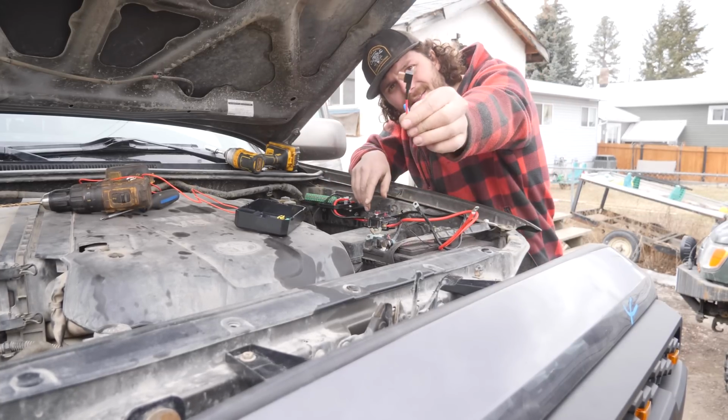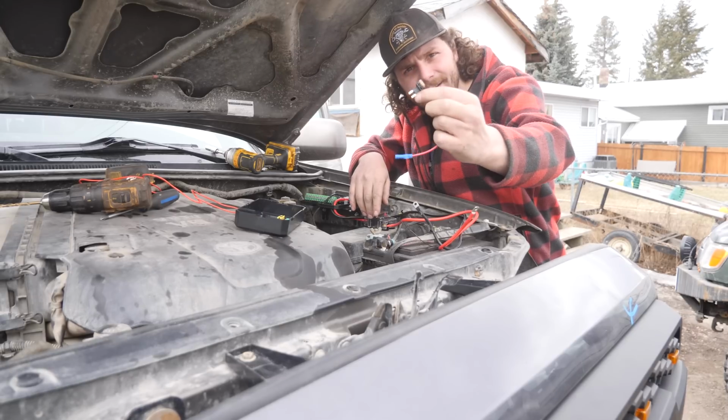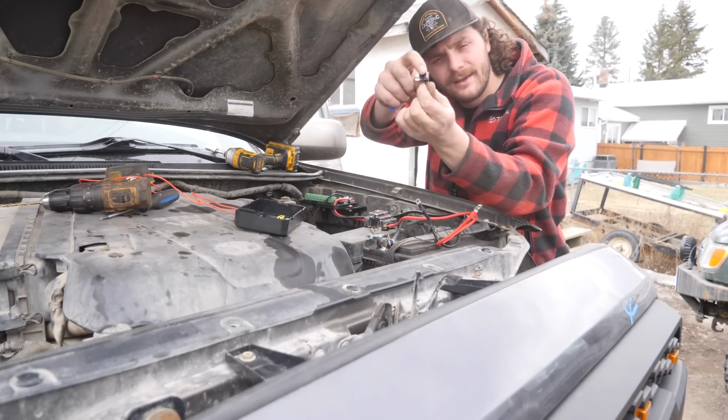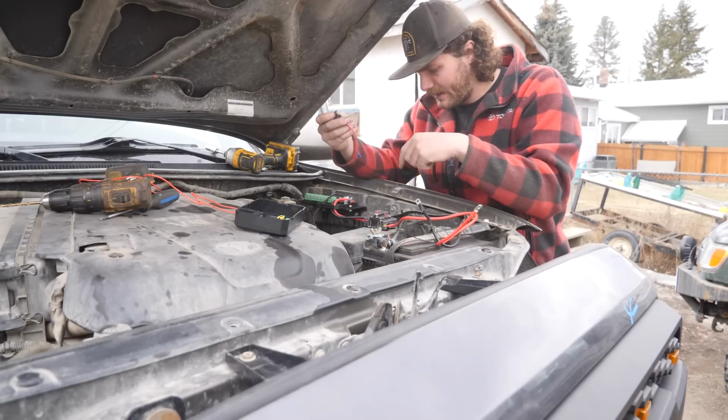With the kit they give you this guy, which is kind of like a fuse extension dealio, or doubles. So you find a switched fuse spot, you ram that guy in the fuse place, and then look, you got a spot for 2 fuses, and a wire to send out to this guy.